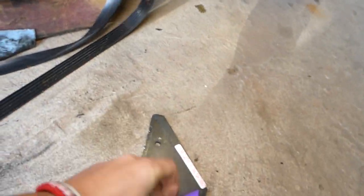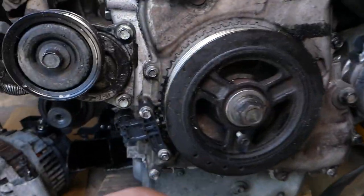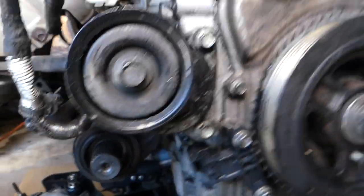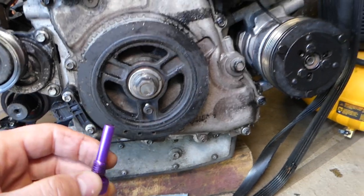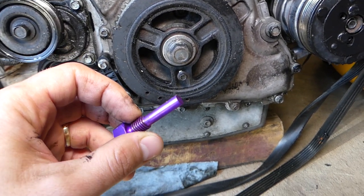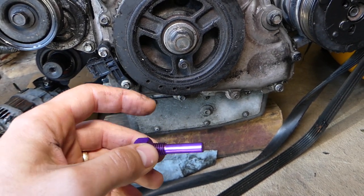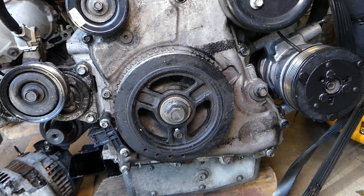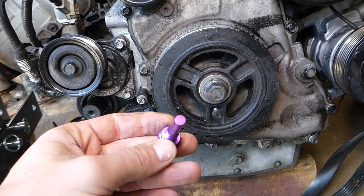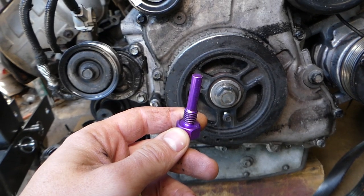You can also use a locking pin for the crankshaft. There is one bolt that you need to remove right here — you install that pin and turn the engine clockwise until it stops. It's going to contact that pin, which means this is the top dead center TDC point. Then you need to adjust your crankshaft position sensor accordingly. That's something very important we should have added — otherwise your car will not perform right.